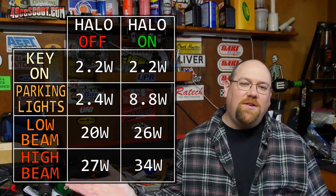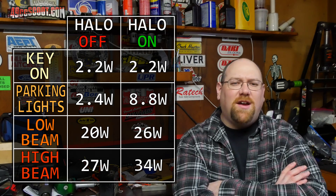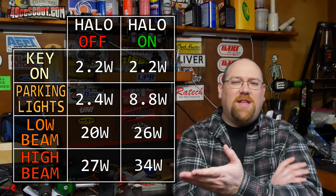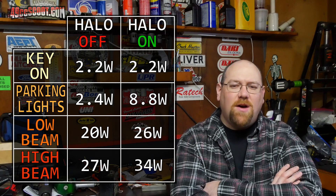I did some more tests, but because my numbers were so far below the manufacturer's specifications — again, that headlight should be 45 watts on high beam according to them, and my entire system is at 34 watts by my measurements — I took a car battery and actually hooked that up to my scooter, figuring that should supply plenty of power and not limit me from seeing 40 or 50 watts or much more. And basically nothing changed. So here is a chart of what I got, with numbers for both the halo on and halo off.